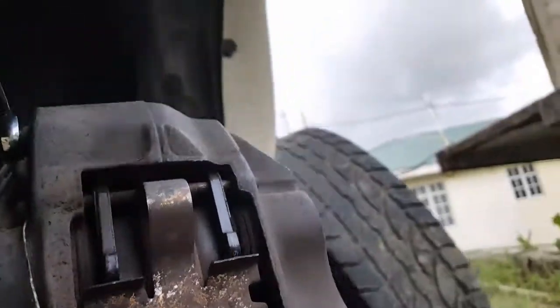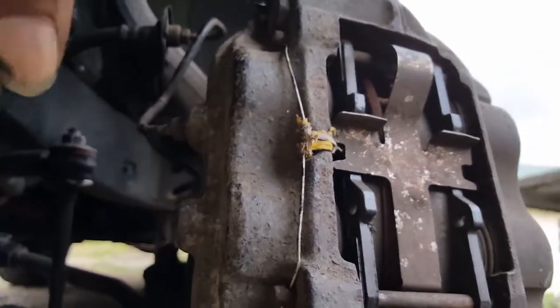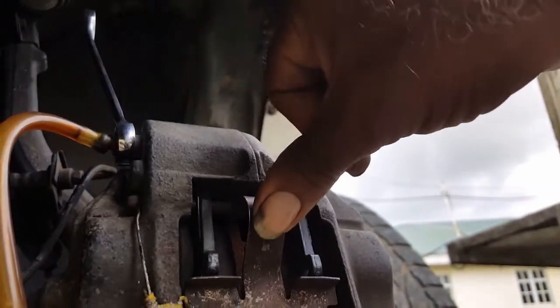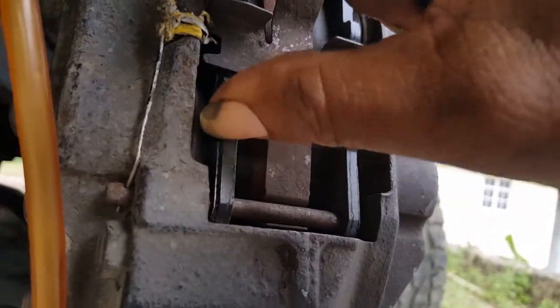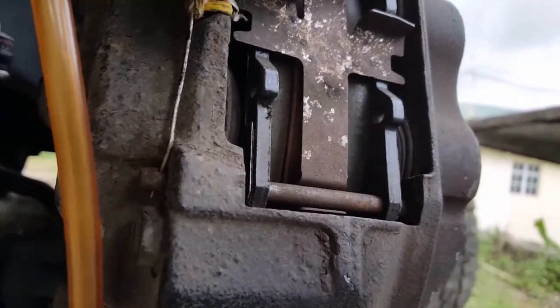The process I went through in changing the pads and the wheel nuts: there are two bolts here, one here and one here. The first step is you take out that spring right here, then you take out the top pin — that's going to release — and you'll take out that bottom pin. Then you will pull out the brakes.